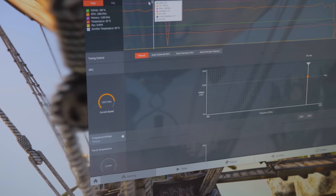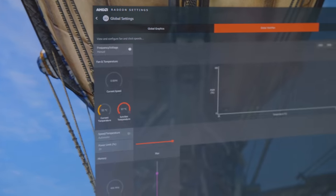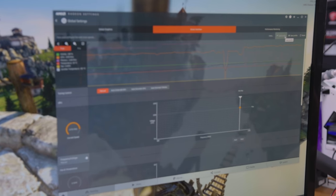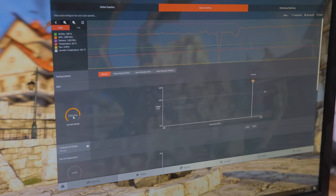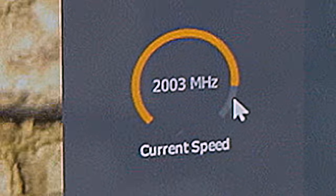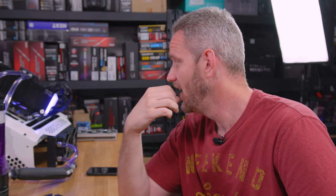I'm curious now — if we play around with some settings, what will happen? It's not going all the way to 2000; it's at 1956. Junction temperature went up to 99°C on water. The temperature shot up to 55°C edge and 99°C junction max. Right now we're at 97°C junction. Let's see if it'll hit 2000 — there's 1977, 1999, and then 2003! It shot right back down to 1987. Bringing the voltage down — 2052 MHz! We couldn't get anywhere near that on air. The fact that we were still seeing 101°C junction temperature on water, but max edge temp was only 56°C — and it didn't even crash, it just recovered itself.